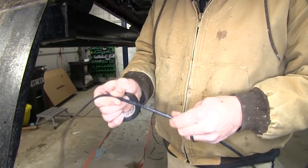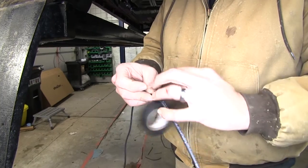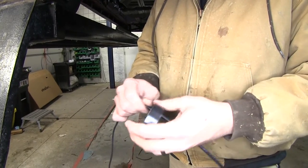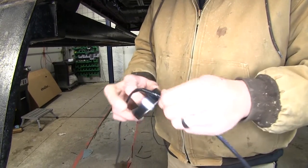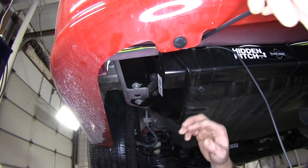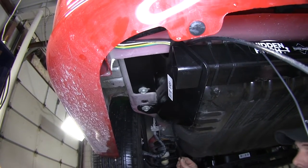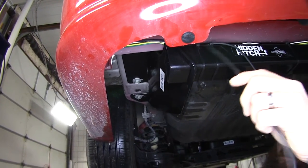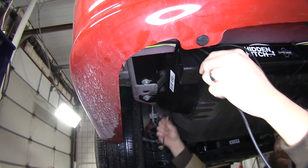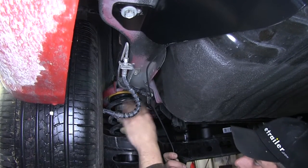The airline tubing gives us a stiffer material to push through some of the smaller areas — coat hangers or a stiffer gauge of wire will also work. It makes it easier to guide the wire through. The first area we're going to feed this through is right between the hitch and the fuel tank — as you can see it goes nicely right up through there. While pulling it through, guide it so it doesn't get pinched. Once we've got it ran up beside our fuel tank, we want to avoid any moving points like our springs.